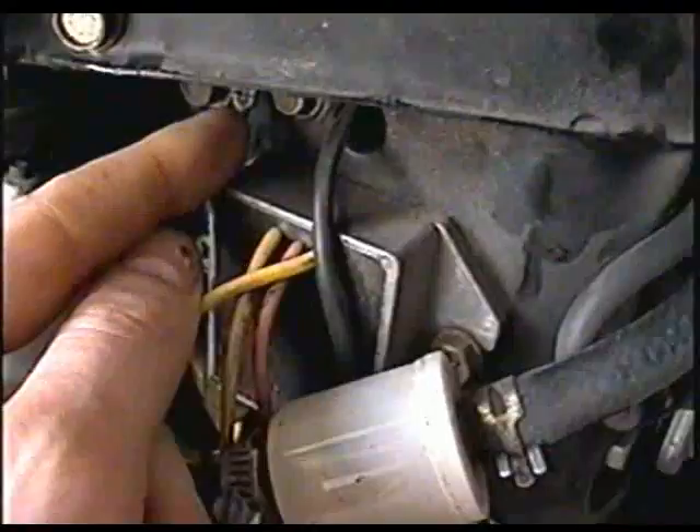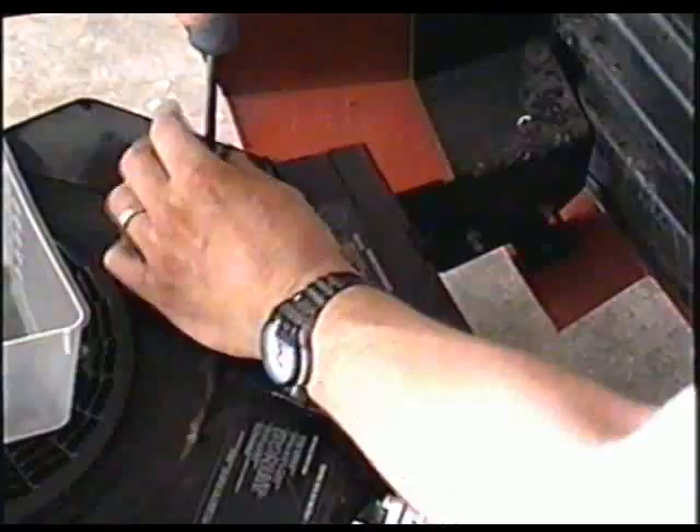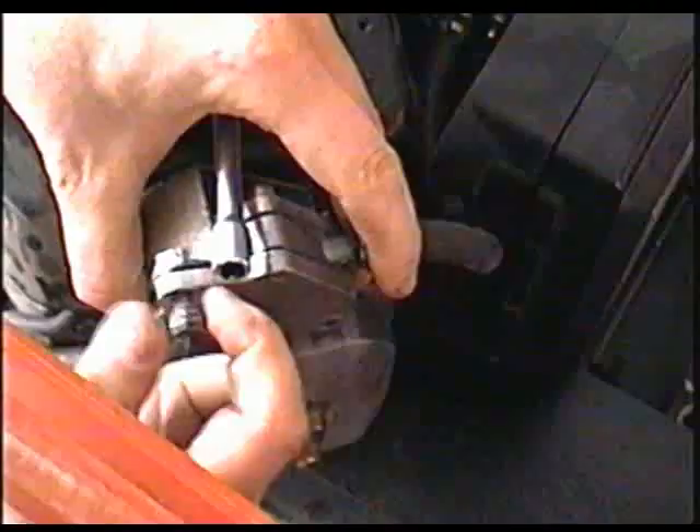So I'm going to be taking this apart today and showing you how to fix this problem. I'm removing the two Phillips screws that hold that grille up here and it's just going to come out — you can pry it out like this. Next I'm just going to remove the fuel pump from the bracket on the cowling, and it's a 10 millimeter socket that you will use for that. You don't need to disconnect the fuel lines — I'm basically removing the fuel pump from the bracket so I can access the bolts on the bracket to remove the cowling.